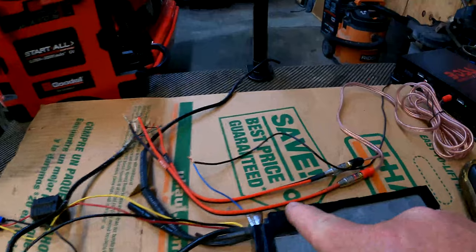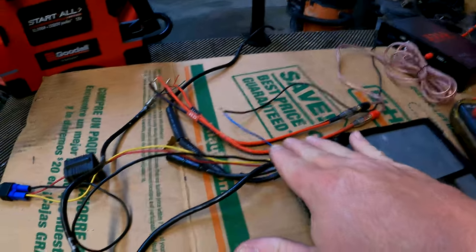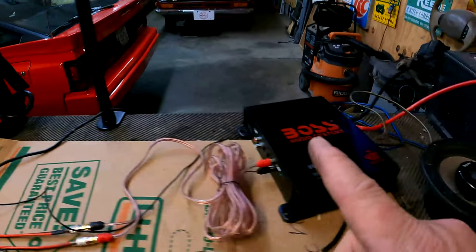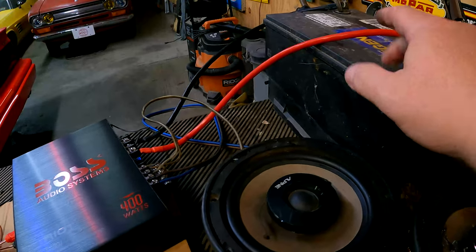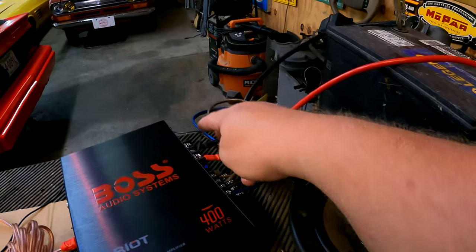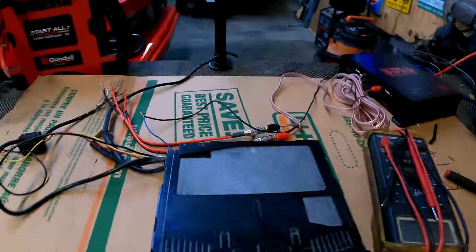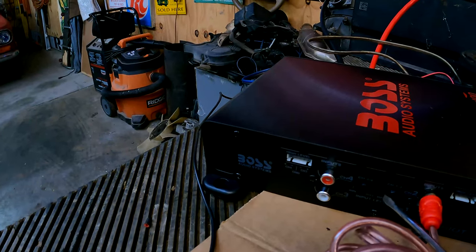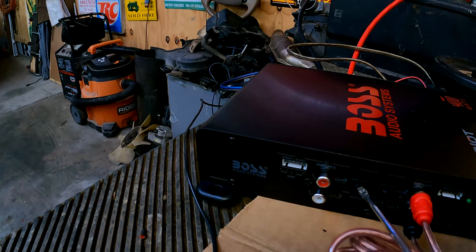Okay, we have our RCAs hooked up, going into our amplifier. We have our radio power hooked up, going to the jumper box, which is definitely turned off right now. We have our amplifier power and ground going up to the battery. We have our speaker leads hooked up, and we have our remote turn on wire running to the radio. Everything here should be right, except I'm going to go to this amp real quick and turn both channels all the way down as far as power goes,